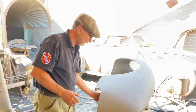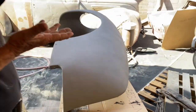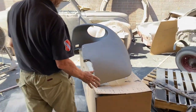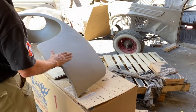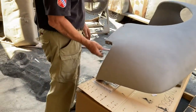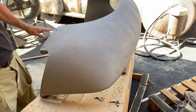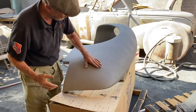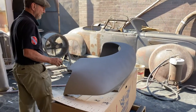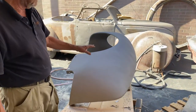Because what you've done is expanded the molecules on one side but not the other. When you're doing bodywork and you have a dip in a fender, you support the back and push it back out — you're shrinking the metal back to the original position it came from on the press. So when we blast, we want to be skipping over it like this — we never turn the blaster right to it. On the edges you can, because it's much stiffer, but when you get out in the middle, especially in that vulnerable area, you definitely want a skipping motion, moving the blaster quickly back and forth. Do not concentrate on one little area — keep it moving, keep it at an angle. You can see how beautifully this fender's come out and we haven't done anything to warp it.